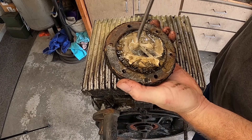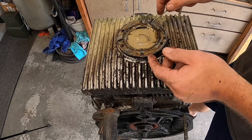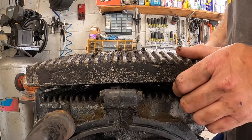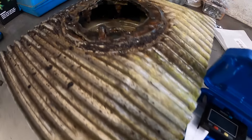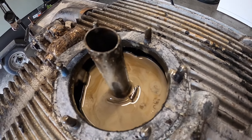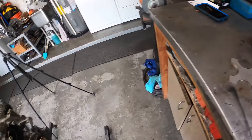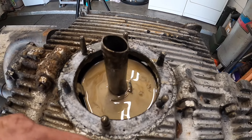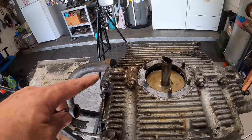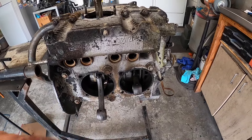It's sat outside for a little while. That is disgusting — so much gunk, junk, milk. He said there was a little bit of water in the case when he drained the oil. Luckily that was in the sump, so the case right here looks a-okay. Of course we'll get everything cleaned up, but for the most part I don't see any corrosion on the case. Now we'll pull all the 13mm hardware off — oil pump's already out — then pull the main case and split it.